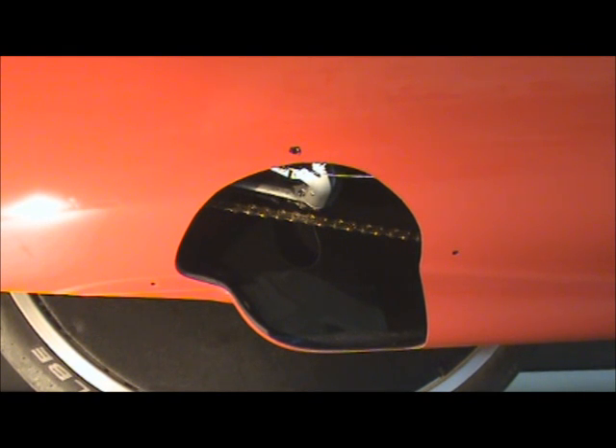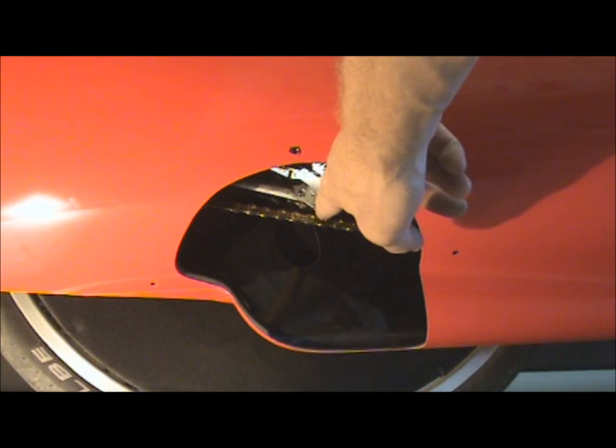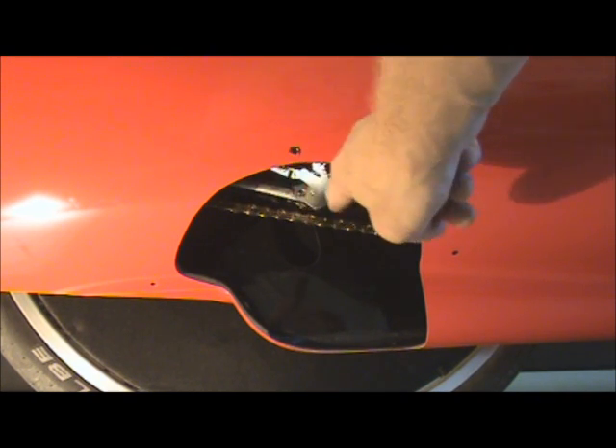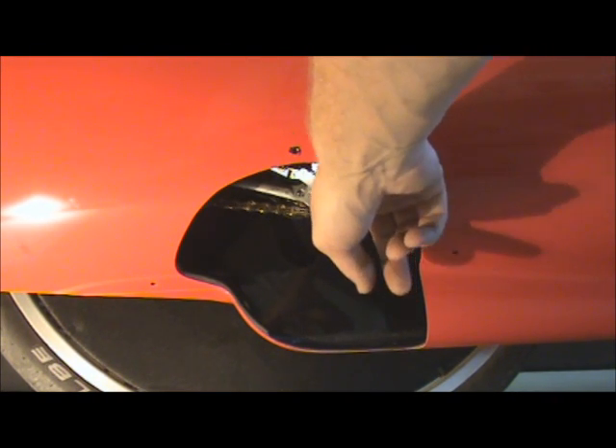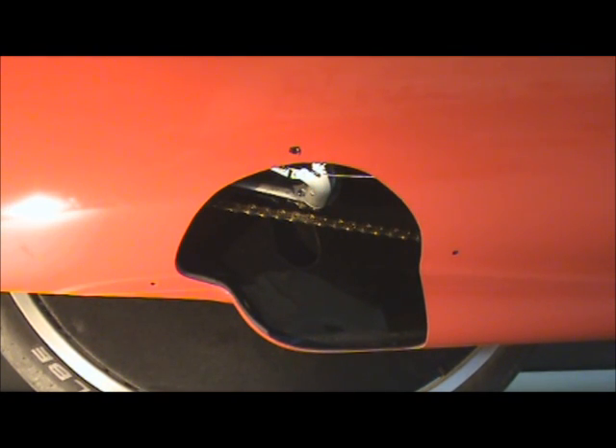The last thing I need to check now is that we haven't gone beyond the limits of the chain length for the drivetrain. Essentially, I've moved the bottom bracket closer to the rider, which has shortened the distance of the drivetrain and created more slack in the chain. So I've put the Quest in its smallest chain ring in the rear and its smallest chain ring in the front at the crankset to create the most slack possible. In this position, I still have a gap and the derailleur is running about parallel with the chain. If the chain were any longer, it would be rubbing up into the derailleur — but it looks like I'm just barely okay, so I can get away with it.